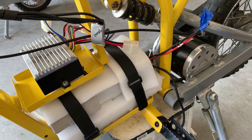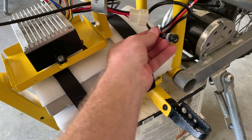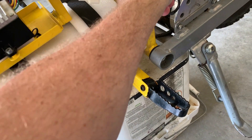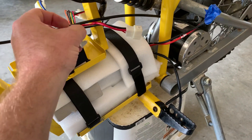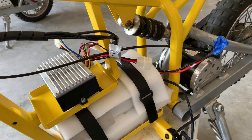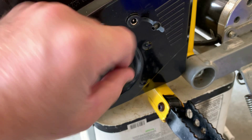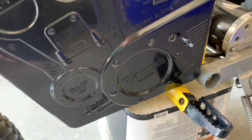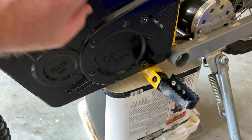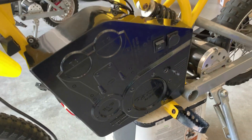Next I'm installing the charge port, which comes out of the battery. I drilled a half-inch hole in the plastic so it sticks out like factory. Alternatively, you could route it out the side and zip-tie it. I taped off the factory charge port through the controller, and I'll do the same on the cover — I don't want anyone to accidentally use the factory charger with the lithium battery. I slid the lithium charge port through the hole, put the weather cap back on, and threaded the spanner nut on the back. The factory plug is now deactivated — you must use the lithium charger in that port.